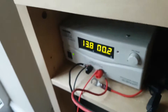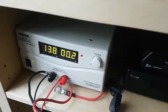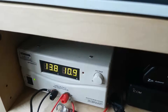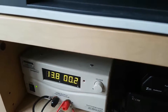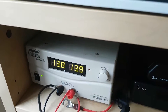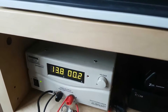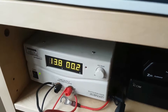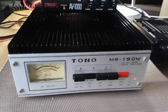Your three settings for amperage: the first one at four watts giving 50 watts output draws 10 amps. The second at seven watts giving 90 watts output is about 13 to 14 amps. The third setting at 20 watts giving 120 watts output should be 18 amps.